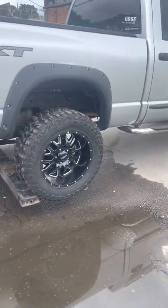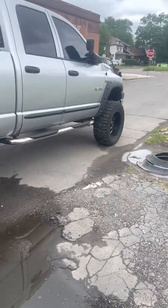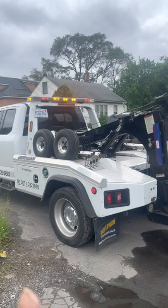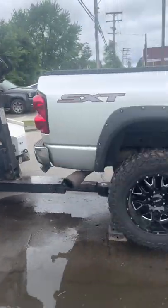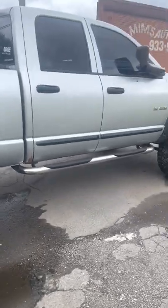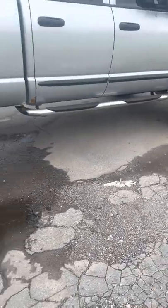Another way people ask me about — how do I tow a BMW or a Benz — is I use those dollies right there. In a situation like a Cadillac, I'll put the tow truck hook on the front and the dollies on the back, because the motor is up front. That way I'm not putting too much weight on the dollies and I don't want to bend the legs or break the poles — they're kind of expensive.